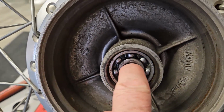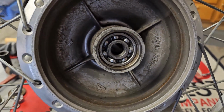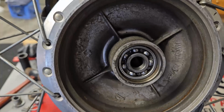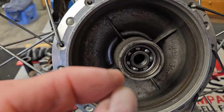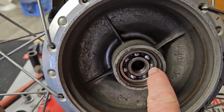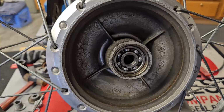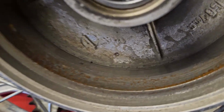But I inspected all the oil or grease. I scraped out all of the grease, and it was that light tan. It wasn't rusted, but it had small little pieces of the chrome plating, or the plating that I believe was on some of these bearings. I probably could just lube these up and put them back in, but the bearings are not expensive, so I've got those coming.